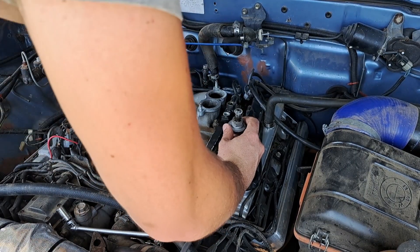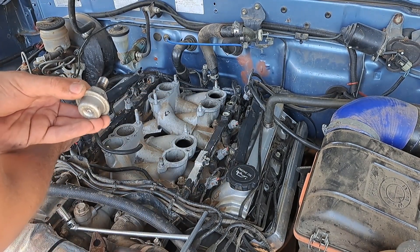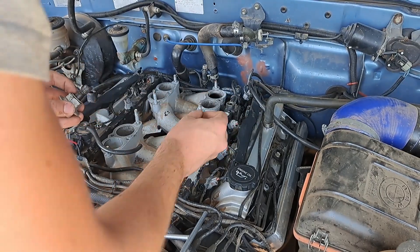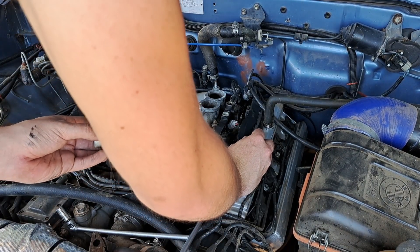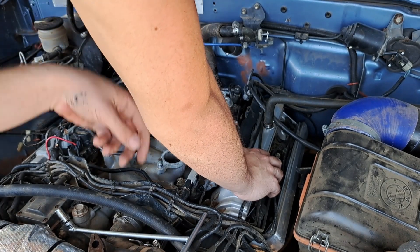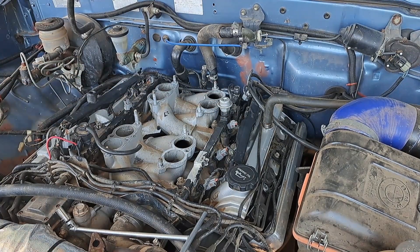Before I go ahead and finally tighten all of this up and go through the final stage of torquing it down, I want to show you this — this is the fuel pulse dampener. Do not confuse it with this, which is the fuel pressure regulator; this serves an entirely different purpose. There's a specific way to put this together: you've got this little crush washer, and this crush washer goes against the fuel rail and sits between the fuel rail and the banjo bolt. I believe this is a 22mm bolt — just need a little spanner to tighten that down. You'll also notice there's a little Phillips head screw on top — never ever fiddle with that, don't touch it, you might throw the entire thing out of whack.